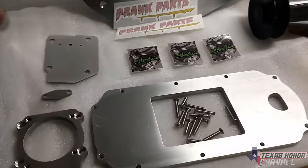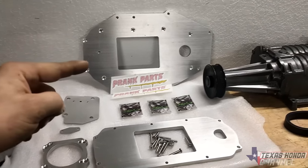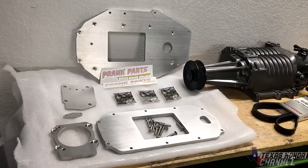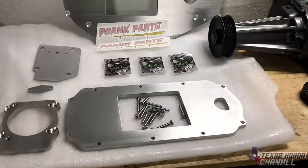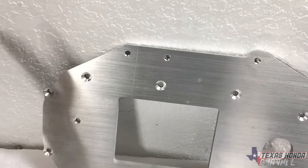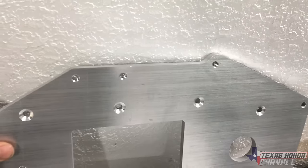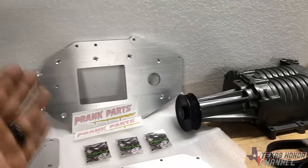So I got the Prank Parts adapter plate. They made a separate video on this. If you haven't checked that out, link will be in the description. Go watch that and come right back. But if you already watched that video, then you're pretty caught up. I still need to go get a couple bolts for the supercharger to bolt it to the adapter plate. Not a big deal. I can go to Ace, Home Depot, or anywhere that sells various bolt sizes. I'll probably take this piece in with me and thread something in just to verify how the thread pitches.